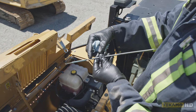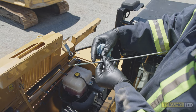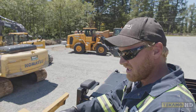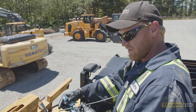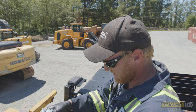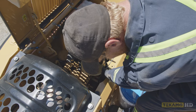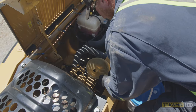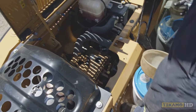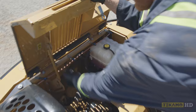Now we're just below the high mark — that's more than sufficient. If your engine is a little older, has a small oil leak, or burns a little oil, you know you have plenty of volume between the high and low marks and you're safe to run it. Make sure to put the dipstick back in, pull the funnel out, put the engine oil fill cap back on, and close the hood.